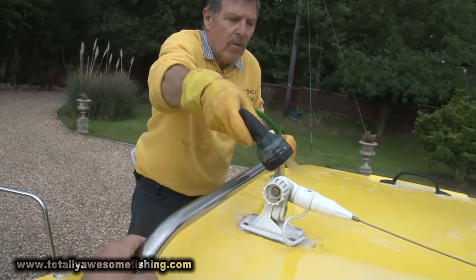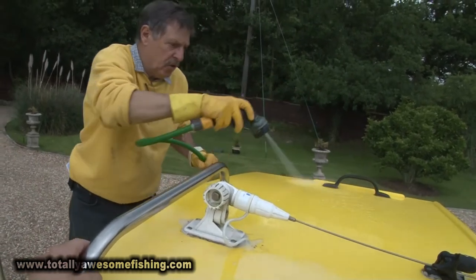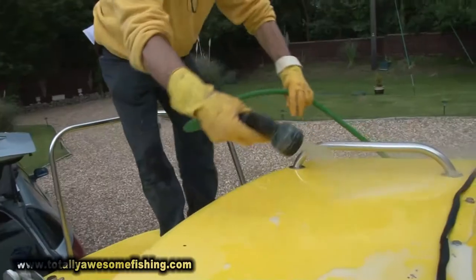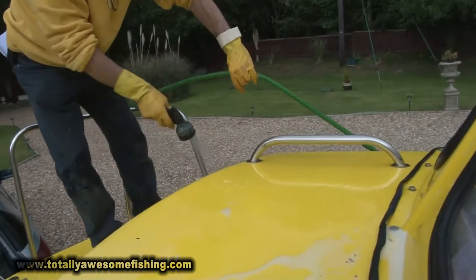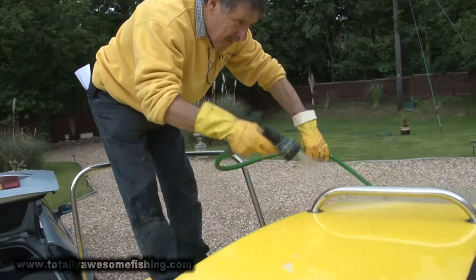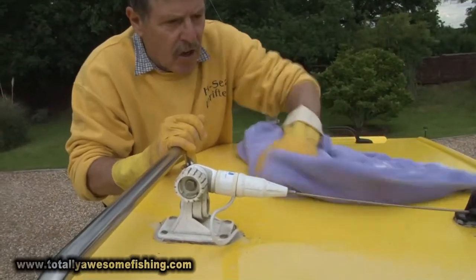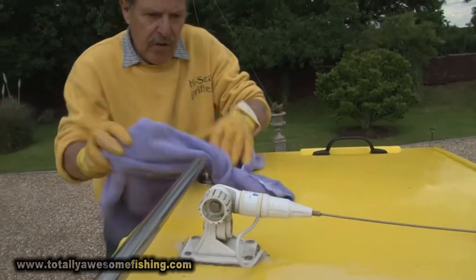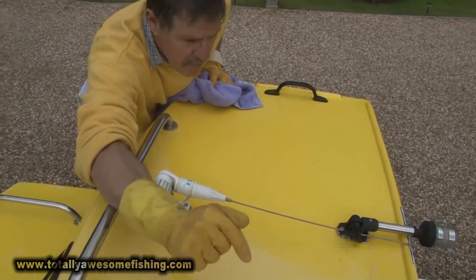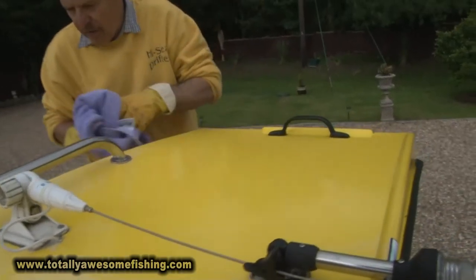After three minutes, just wash all this off with a light spray. I'm keeping it on a 50/50 basis so you can see half the boat — this canopy, this flying bridge — is done, and the other half still has all the muck and grime on it. Because it's clouded over I've worked a bigger area, but on a sunny day work smaller areas. I can see immediately all the rubbish and muck has come straight off. Let me towel this off a bit to show you the difference — this side is smoky and milky, but just look at that side. We haven't even done the stain removal yet.